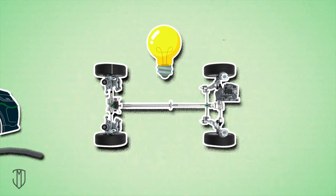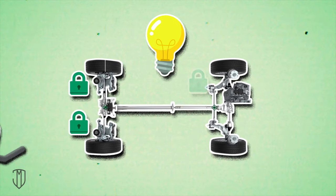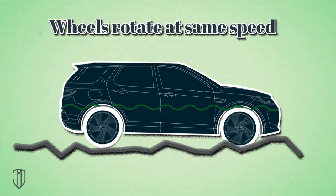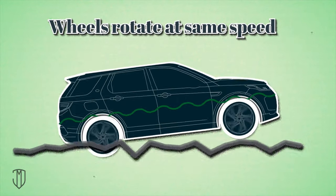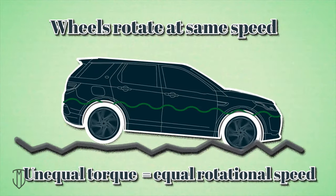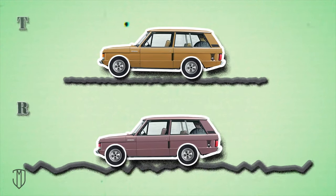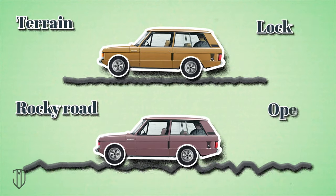That's why engineers came up with the locking differential. It essentially locks both wheels on an axle, forcing both to rotate at the same speed regardless of traction at each wheel. Each wheel has as much rotational force as the traction under it will allow, and the torque on each side shaft will be unequal — in other words, unequal torque, equal rotational speeds. Exceptions apply to automatic lockers. A locked differential can provide a significant traction advantage over an open differential, but only when the traction under each wheel differs significantly.